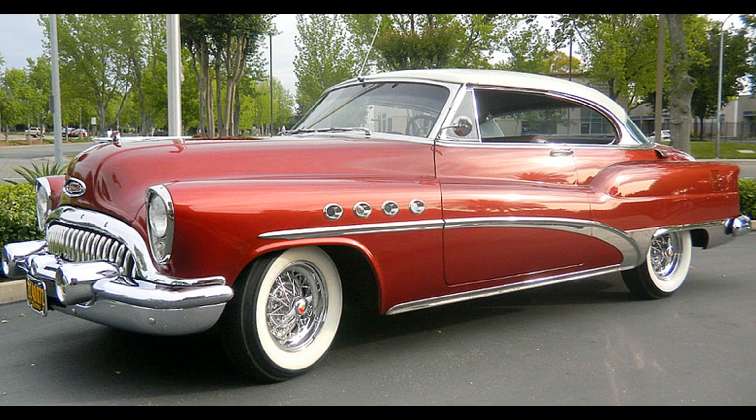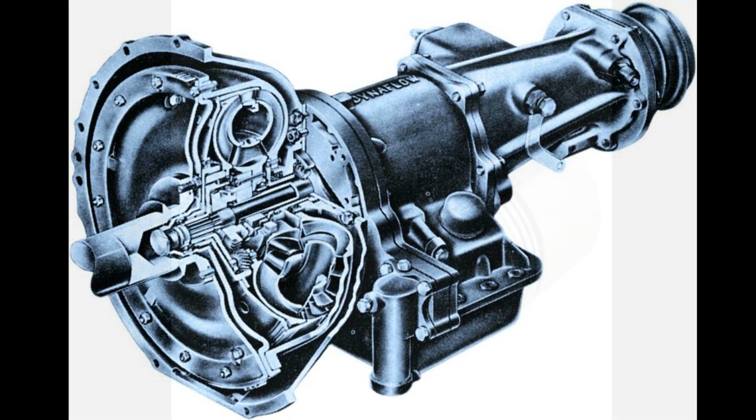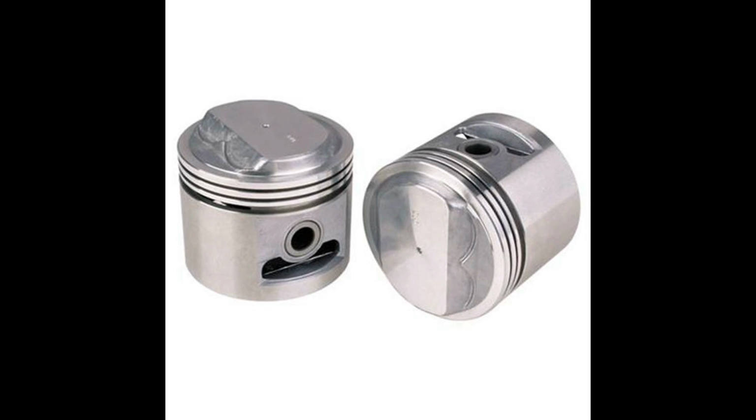But that was little concern to Buick engineers, who were optimizing the engine for smooth, economical operation in large sedans. Coupled to the division's torque converter-based Dynaflow automatic transmissions, the Nailhead V8 provided great gobs of torque for silent and effortless performance, exactly as intended. Domed pistons were required to obtain the desired compression ratio with the fully machined pentroof combustion chambers.